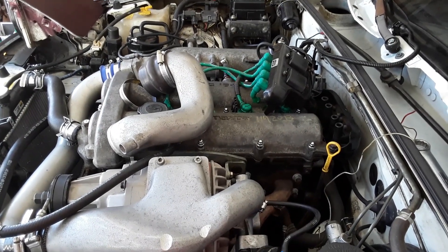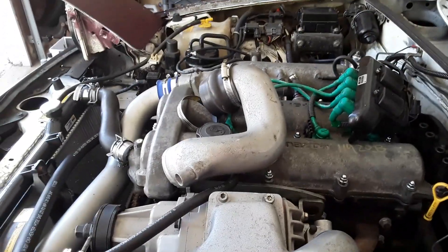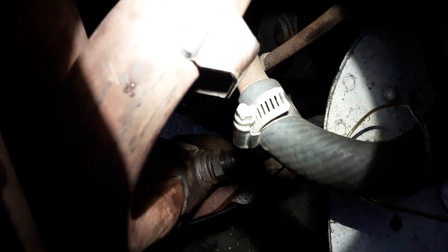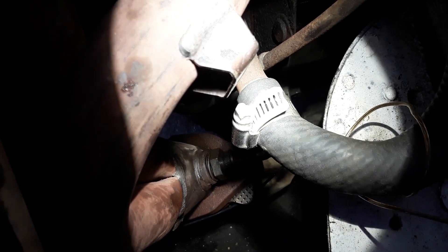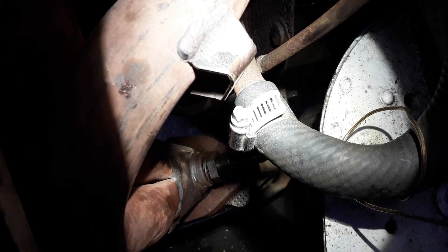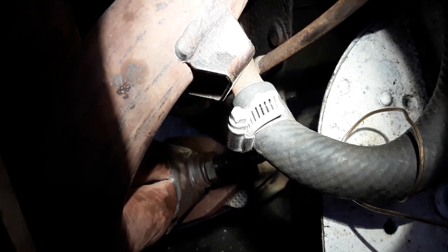Please don't let my mistake go to waste. If you're going to install a wideband sensor, do all this before you put the supercharger in, or else it's going to be kind of a pain to remove everything. So remove that U-pipe, remove your throttle body if you made my mistake. If you did make that mistake, you can find your O2 sensor on the downpipe right before the midpipe. Mine needed a 22mm socket to break it loose. Use some penetrating oil to help you out — it can be tricky. Break it loose and remove it before you even start doing the wiring for your new wideband, because if you do all the wiring and you can't get this out, you're in a world of hurt.